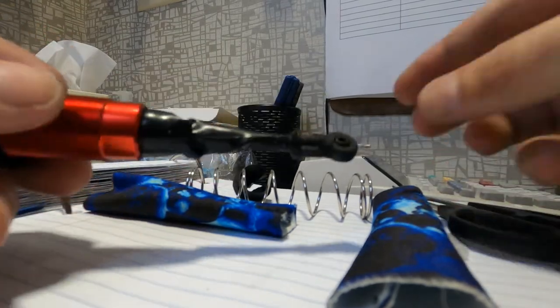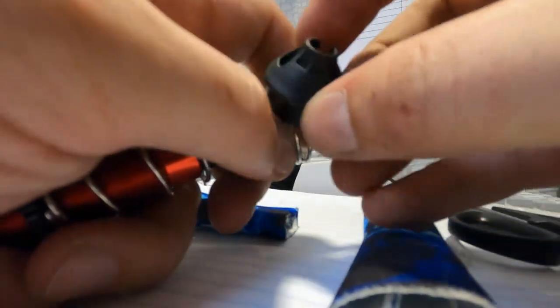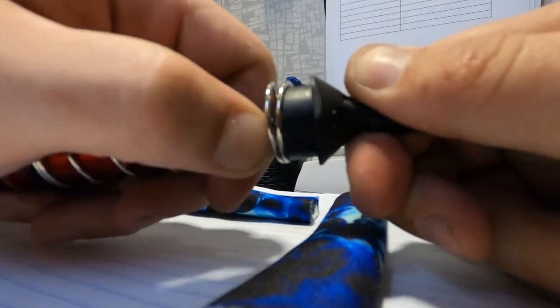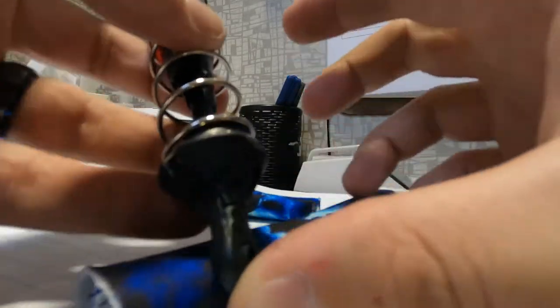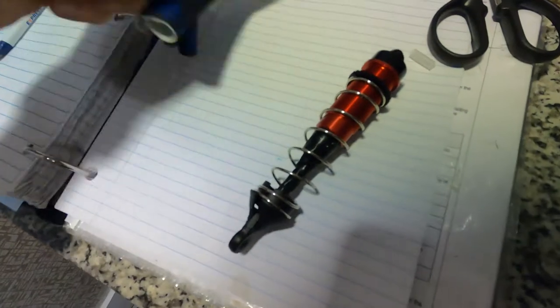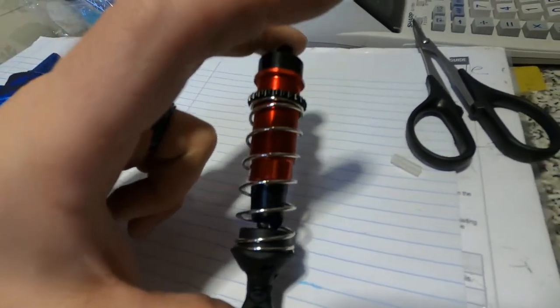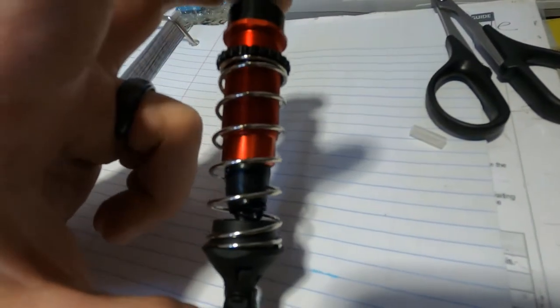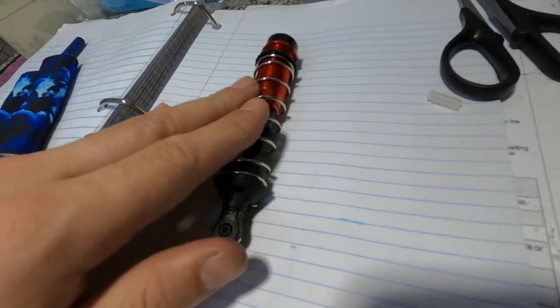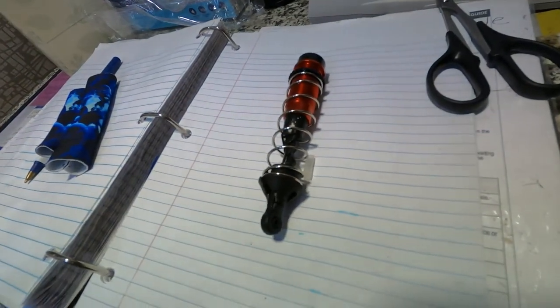You can't see it once it's in. Then you just put your spring on, put the little cup back on, and get the spring around it. There's your shock — it's complete. Now see, that's as far as it goes. It still shocks and travels, but it won't go any further than that. And that's going to help you. This one little piece is going to solve all your troubles.